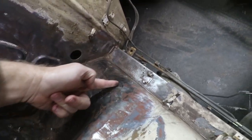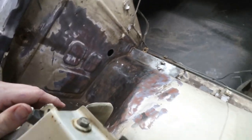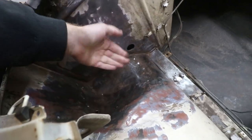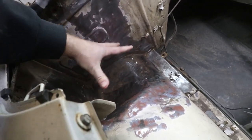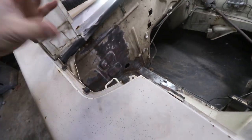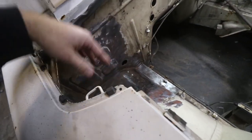So that's the plan - probably just going to cut straight up along here, leave a little edge here to butt weld up against, and then same thing here. We'll leave a little bit of a gap but we're just going to cut a little bit at a time. Try to get this all in one piece, patch that, and get that piece fit and molded in, and then see if we need to cut any more out and make little pieces from there. That way I don't have to make one big complex piece.